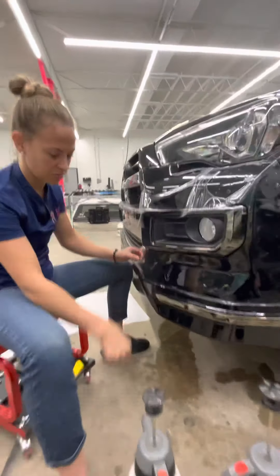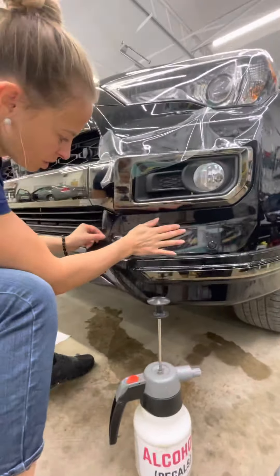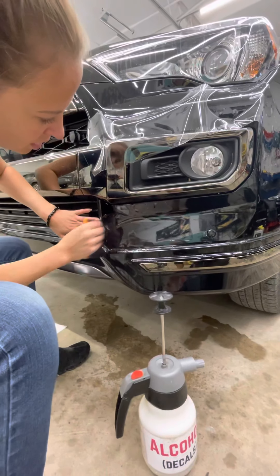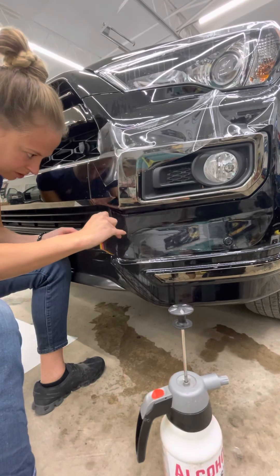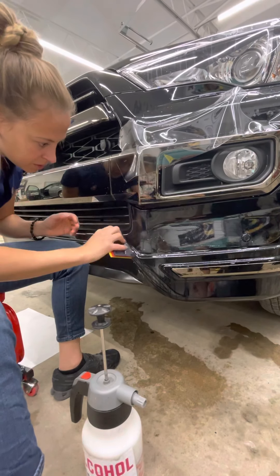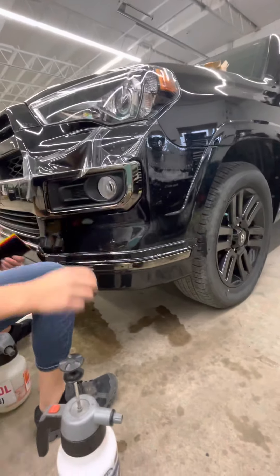Then we're going to bring this piece around — this piece has to go up and around here, and also has to match up here, so we've got to stretch it just a little bit. I'm going to push with my palm to create the round effect underneath here so that it's lined up, and push out to that spot. Again, in that crease with my squeegee, following that same line, pushing the water out that way. Double squeegeeing, then locking this edge in once I get here. If it doesn't lay down, just give it a little bit of alcohol. Re-squeegee, then take a piece of paper towel or microfiber and make sure that you don't leave any bubbles and that the top edge is locked in — otherwise water will just keep coming down.